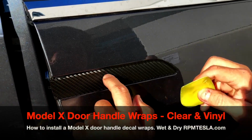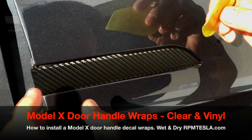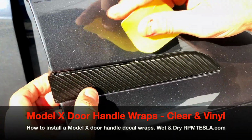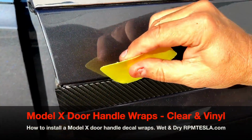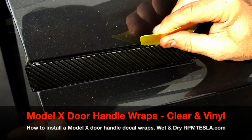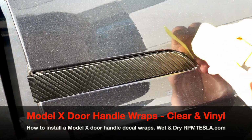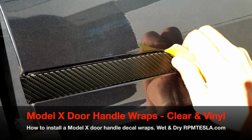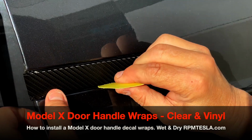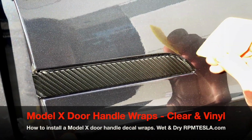And now we're gonna look at the top. See how I'm making a ridge with my finger? All this is gonna get wrapped inside the door handle. So let's just start right away. And again, you're just taking the squeegee and you're forcing it inside. Just push it in there and you're sticking it down to the chrome that extends inside. And again, just keep pushing it in, forcing it down. It does wrap around. And then same thing on the bottom, through the bottom edge, and you're pushing up. So you're pushing it down, in, and then up.